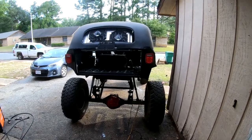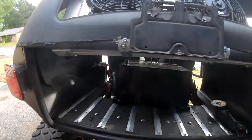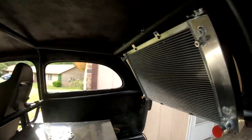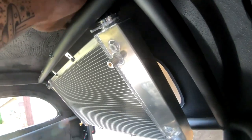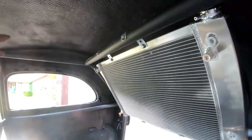As you can tell, I already have the radiator mounted in the rear where I want it. Used some steel straps, both of them on each side, both attached to the roll cage on top as well. I'm going to have to drill a hole in the roof or figure out a fill apparatus to make this work with the roll cage. You can still take the cap off, but filling is going to be tough.